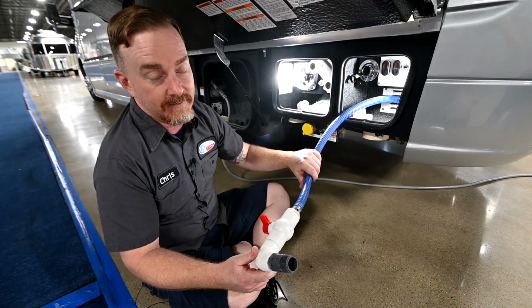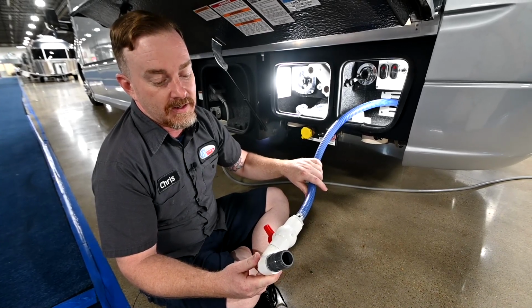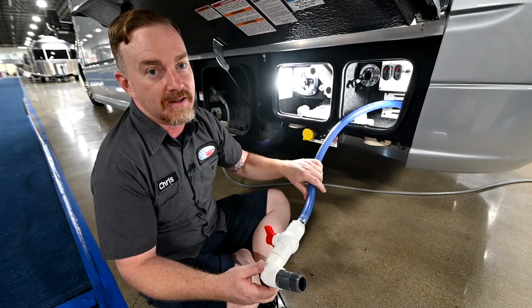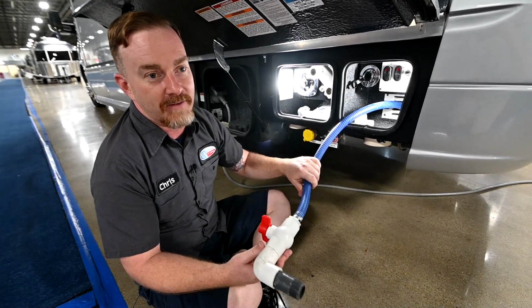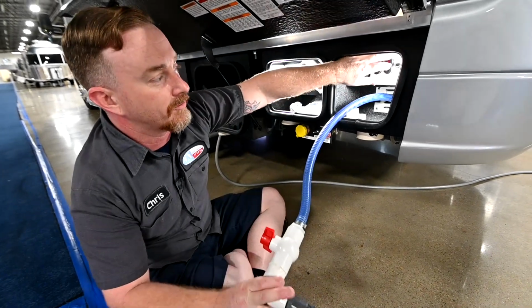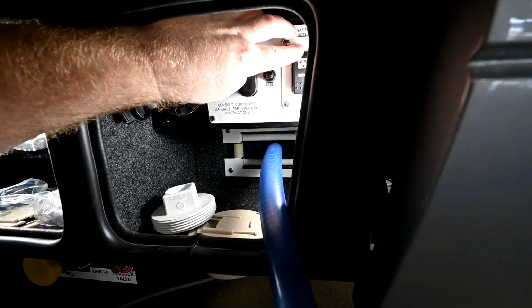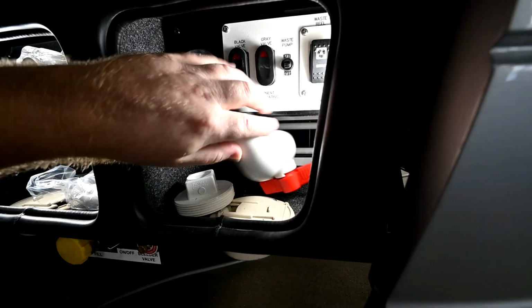Once it's as clean as you can stand, close the valve, allow it to backfill until the waste monitor inside reads about 5% full. At that point, turn your water off, go inside and add your tank chemical straight into the toilet. You should allow the black waste tank to sit around all the time with about this much water in it. So as you're driving, that water is sloshing around, helping keep the sides of the tank clean so that your sensors read good.